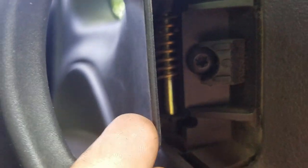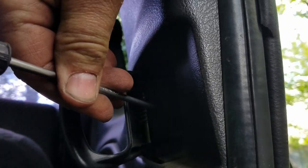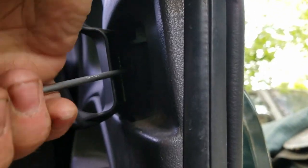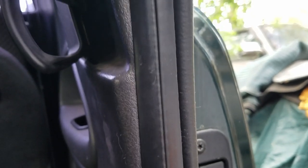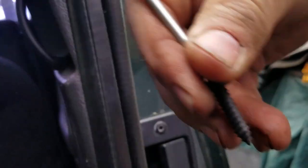First thing you want to do is come in here, find your latch, open that up, then take that torx bit out. It's a lot easier to work on these when they will open instead of trying to cram in behind the back seat. So once you've got that guy off, we're going to take a Phillips and get the door handle cup taken out.